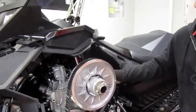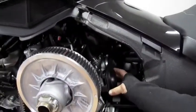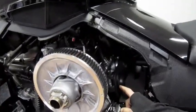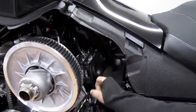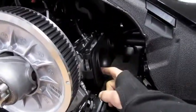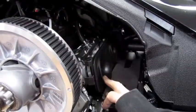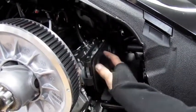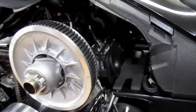At the back of the machine, the throttle bodies are located where the carbs used to be. They look something like a carb, but there's no fuel running through them — just air. These throttle bodies have a diameter of 52mm, which is quite large. On the carbureted sled last year it was only 40mm, so there's significantly more air coming into the sled.